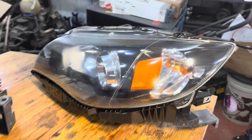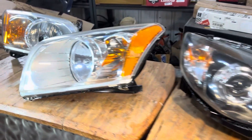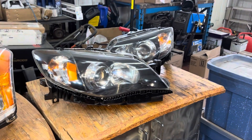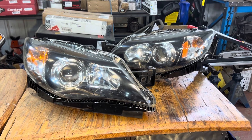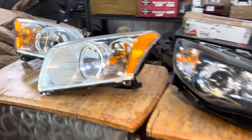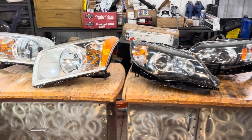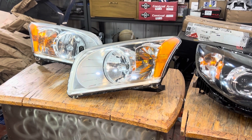Honestly, from 800 grit you leave it at 800. That way, when you hit it with a clear coat it has adhesion and it's going to stick there for a long time. If you polish it up to 2000, 3000, or higher thinking you'll do a better job, it might look good at first, but long term the paint can't stick to it and it's going to flake off. So if you follow the steps I showed you, you can have high-quality headlights for a very low price. Go with the spray cans, do it all by hand in the car — 50 bucks and it'll last for years, instead of 50 bucks and having to do it again in six months. Hope you liked the video.